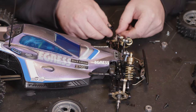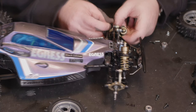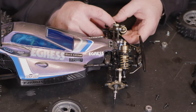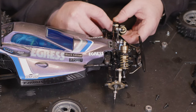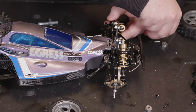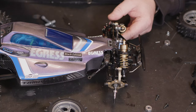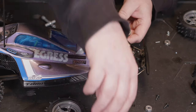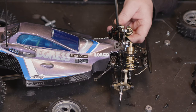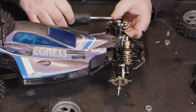Remember your little spacer on top — you should just be able to slide these back into position, and then your bearing will carefully slide inside it. Then we've got to get the little shim underneath, carefully line it up, and drop your kingpin back through, making sure you go through the middle of that spacer. Once you've got that in, you can tighten your kingpin down and it should have nice free movement.